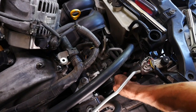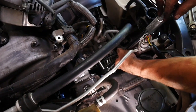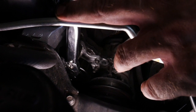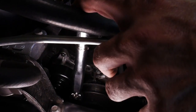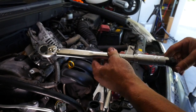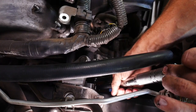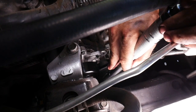I'm not going all the way until the torque wrench clicks on the first pass — just getting it snug. Now I've done a full rotation of all the bolts, and I'm going to actually tighten them to torque. The back bolt is a shorter one so that goes to 6 foot-pounds, then back to the 8 foot-pound bolts. Last one — done.